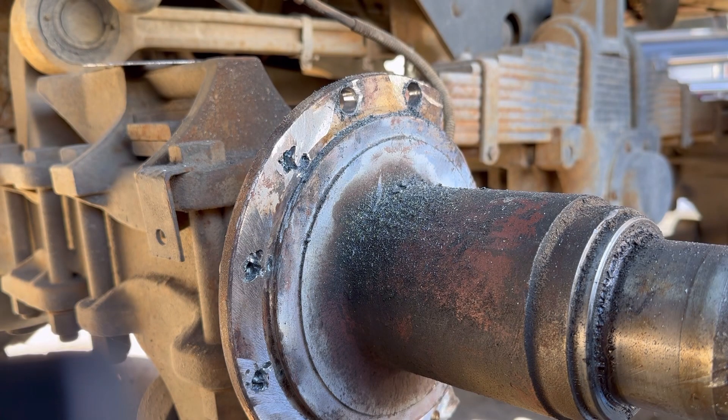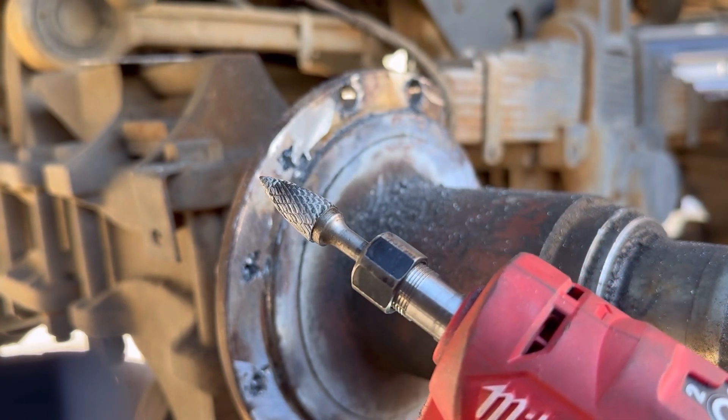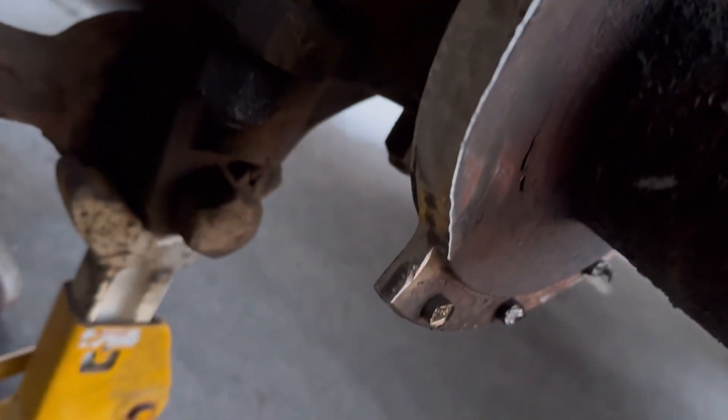So I'm enlarging these holes up to a half inch. I tried to send a drill bit through them but it's just wiping the edges — there's just not really enough meat to go from what they originally are up to a half inch. So I grabbed a carbide burr and decided we're just gonna rip through it with carbide, and that's working pretty good. This is brake three of four on the back of this truck that I've done this way. Here's how we do it — get all the plasma cut cleaned up, and you can see there's this little rib right here in the back. Once you start grinding that flush right through that center part, that'll give you enough clearance to get everything all bolted up and get it working.